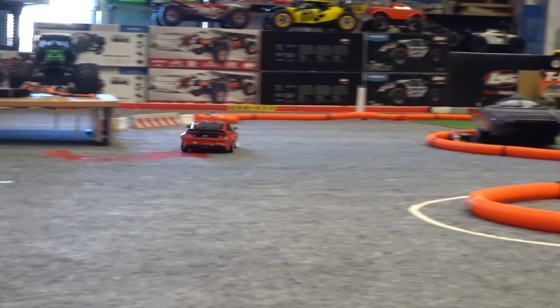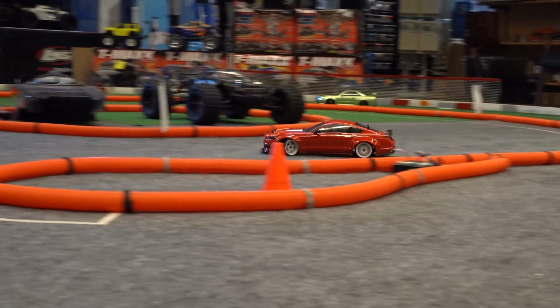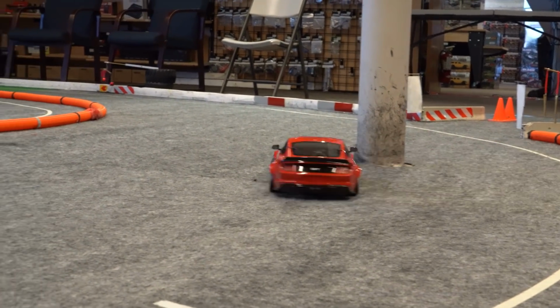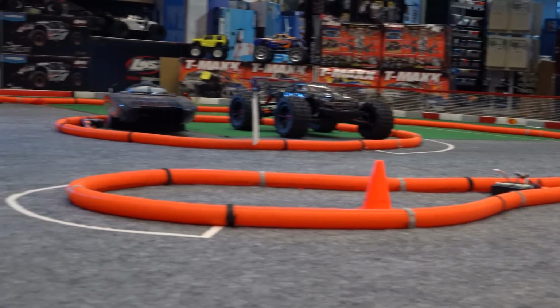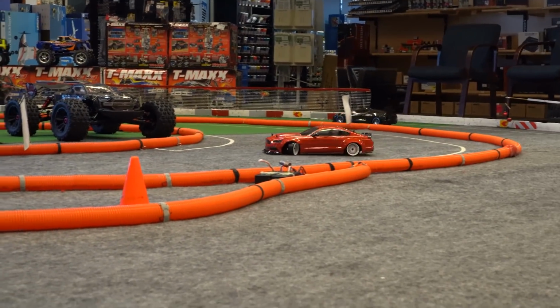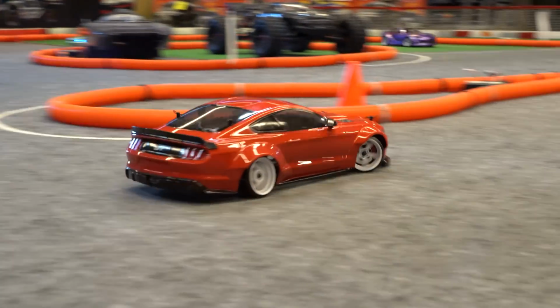Drifter night is happening in a few hours and people are already on the track, but the improvement from that high motor position was an immediate feeling, in the way the car swings out and extends its drift angle within control without looping out. Transitioning from left to right or vice versa felt more stable too, or maybe smoother. I'm kind of lacking the proper words to describe the experience, but this high CG motor change is so far the best thing we've done in terms of adding comfort and control to the car.